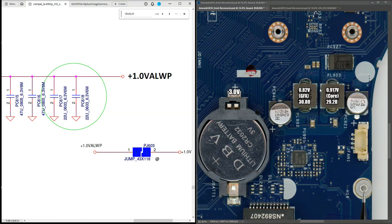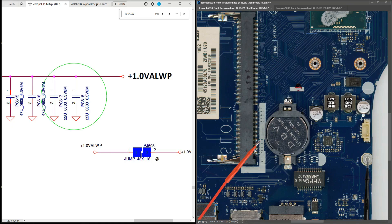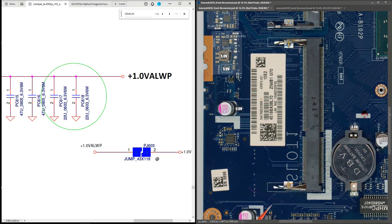Before moving on, I powered off the laptop, switched the multimeter to resistance mode, and took resistance readings at both of those coils to compare with the other laptop later. The BIOS battery measured 3V, which is fine. Further down the board I measured 5V beside the USB ports. With the laptop powered on and seemingly working, I plugged in two USB devices and they powered on fine, so there's no issue with power to the USBs.